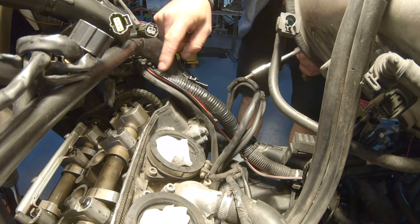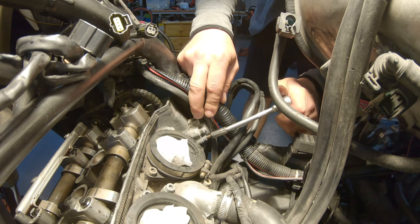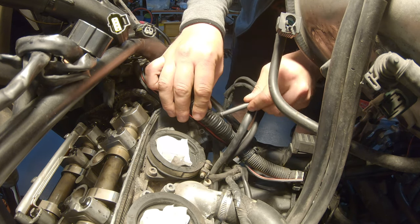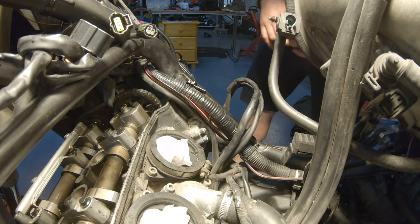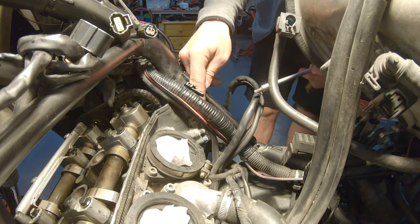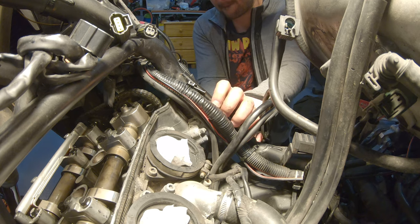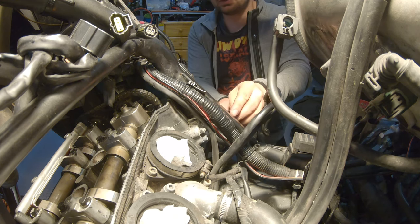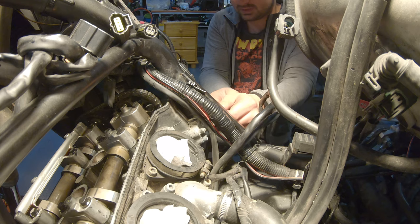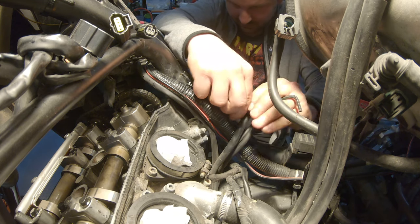So this is the chain tensioner here. Two little bolts you have to remove. One. Obviously it's not easy to access. Second bolt, because there is the frame in between. Again, need something special. So for the second one, we use this one. You can access between this triangle that we have here and just loosen it up a little. Then we can go in from this side.